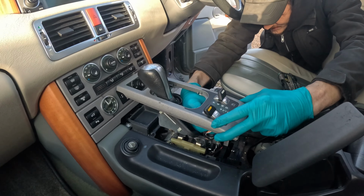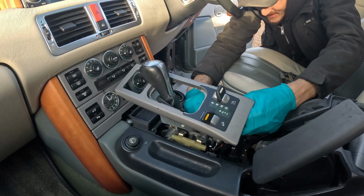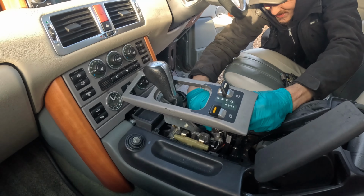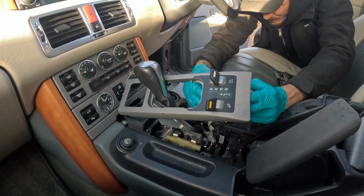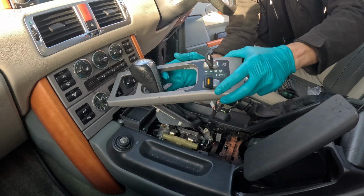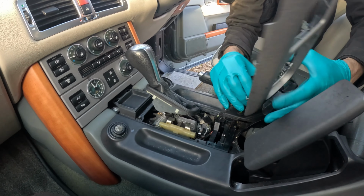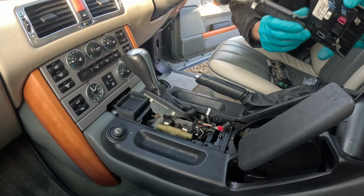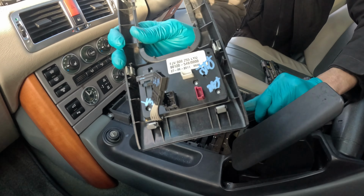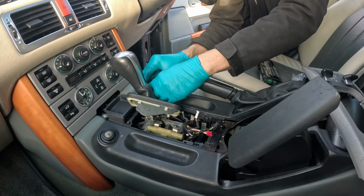And again, because he's such a rubbish cameraman, didn't even show you the tabs. There's two little tabs you've got to knock to be able to get that boot off, and then just unplug about 4 different plugs under there, and that's how you get your centrepiece off. At least that gets it out of our way. So, 10 plugs out there, there's a few of them. Not too hard, get a bit more space in here, because that's what we want.